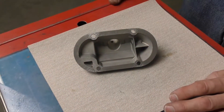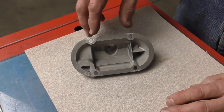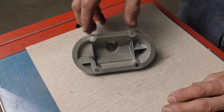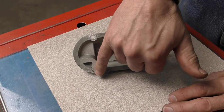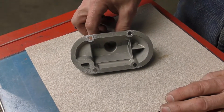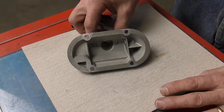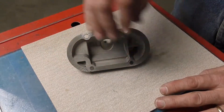The next thing I want to do — I've finished drilling my holes — so I'm going to have a slight burr here, but these covers are prone to warpage where they get tightened down. We've also got a little bit of corrosion around here. So there are a couple of ways to resolve this. We could use a power sander or a flat wheel that gives a nice flat surface.